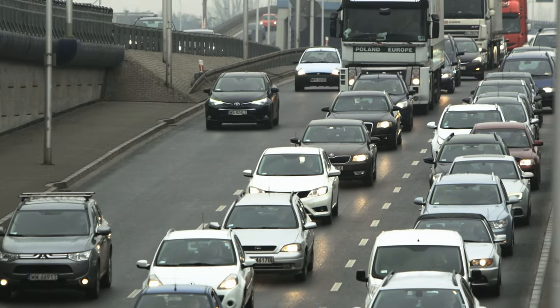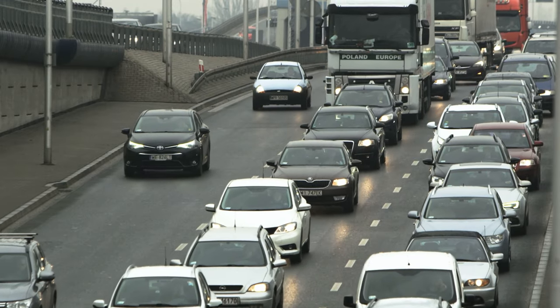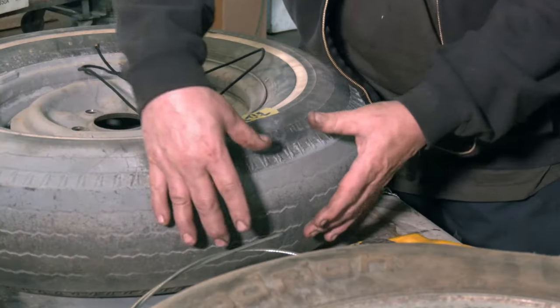On passenger cars on the highway, you almost never take all four wheels — or even one wheel — off the pavement no matter what you're doing. Because by the time you get that one wheel almost off, you're about to crash. When the contact patch on any tire gets really small, you lose adhesion to the ground — and that means you're spinning or sliding, which almost never ends up in a good thing.